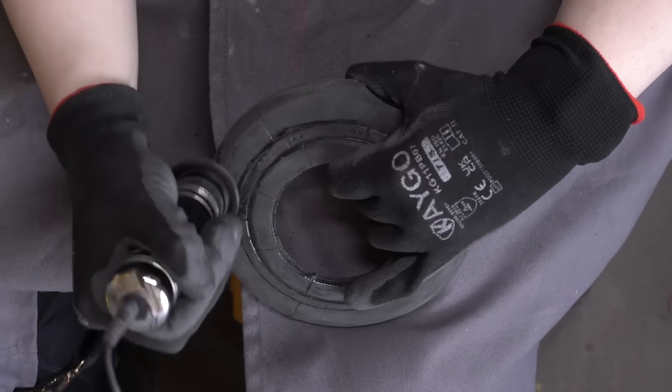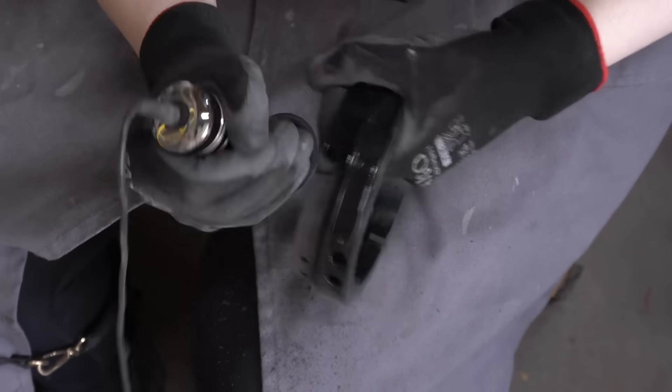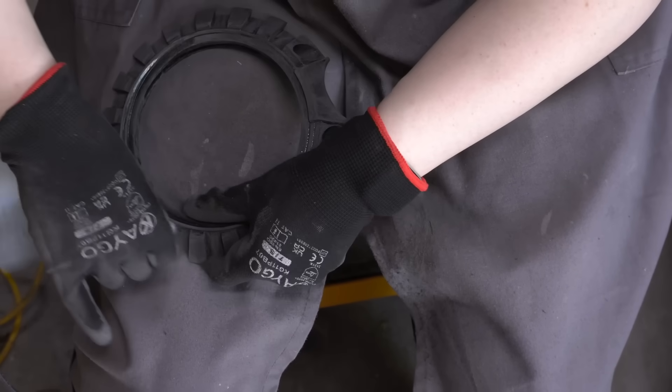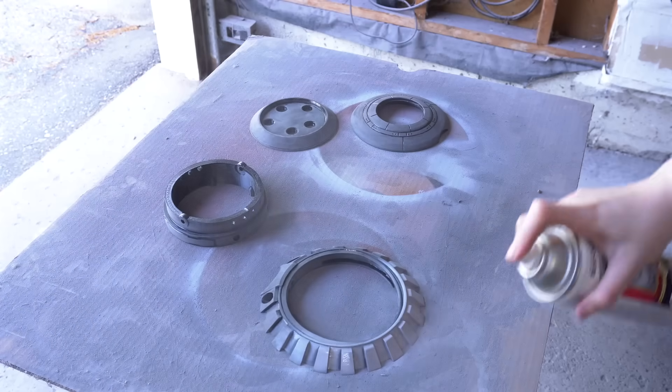This is about the time I started to do a whole lot of back and forth to try and be more efficient, so I only sanded the largest of the body parts so that I could get that first round of filler primer on them, and then while that was drying I went back and sanded all of the other body parts to then get the first round of filler primer on those.